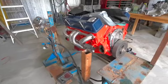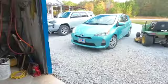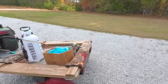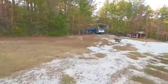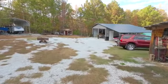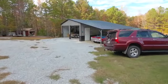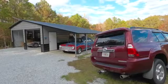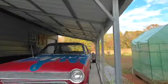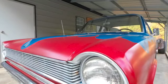One of the things I'd like to do is use these header pipes. I'm running standard pipes on that Rambler. Let's go ahead and look at the Rambler — there are a couple of things. I need to take this wagon load of stuff back there too. We'll pop the hood on the Rambler and have a look at it because I think I ordered all of my parts for a short shaft setup, and I need to know whether I've got a short or long shaft water pump on the Rambler.